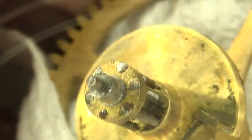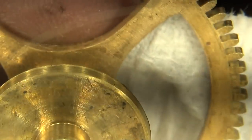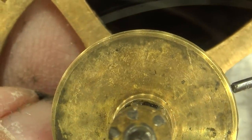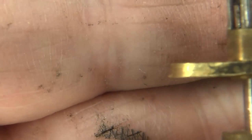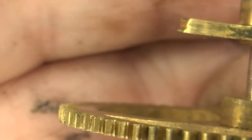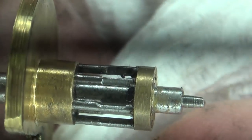Now, I was telling you about this cam. Under the magnification, you actually see this ridge. There's a ridge back here that shows that that thing is worn down. Maybe you can see that ridge if you look at the bottom edge of that cam. See that ridge? It comes around. It should be just straight across. You can see it's at an angle. Has a ridge on it, which means it's worn. Yeah, barrel shaped.